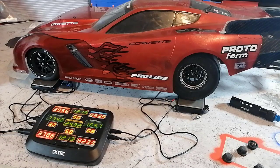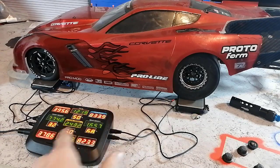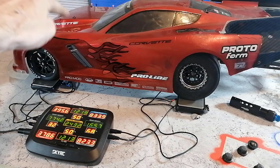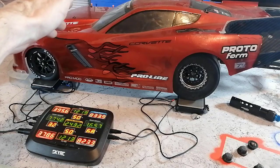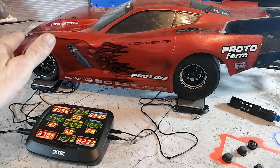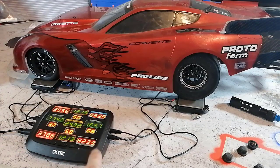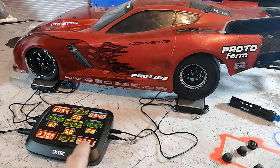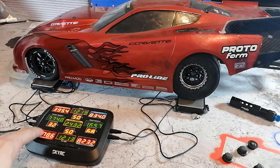The balance and relationship between corners that is more connected is the cross corners. If you increase or decrease the ride height on the front left, this is going to have a larger impact on the rear right than anywhere else. That's why when you're doing the corner balancing and trying to adjust for a particular wheel, you do most of your adjustments on the opposite wheel — if you want to increase the weight over here, you make your adjustments on this side over here.